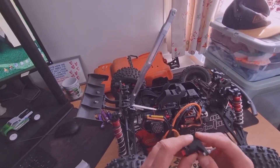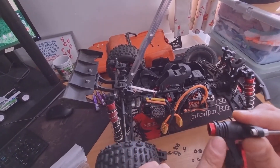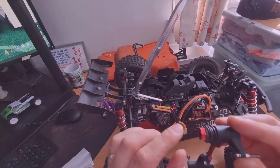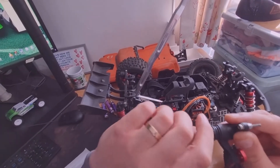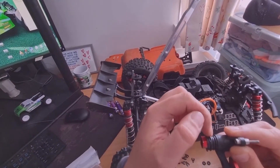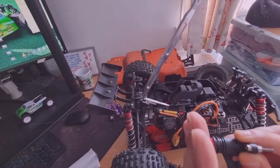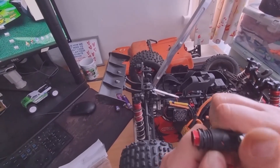I've taken off the steering rack and as you can see I've modified it by putting some circlips around the bar — there were zero on there when I got it. I've put one, two, three, four on: simply undid the bolt, pulled it off, slipped them on, put the cup back on. That's probably about four, maybe five millimeters worth of pushing the spring up tighter.